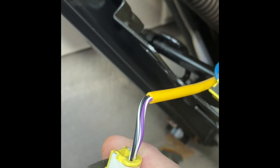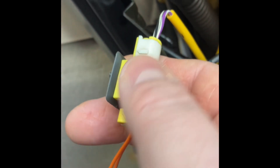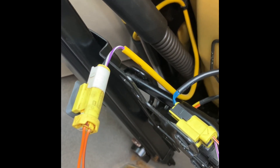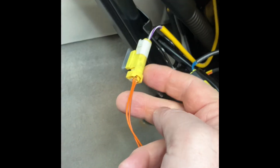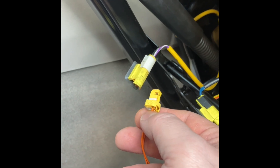I'll begin at this end here that meets up with the white and black wire — that's very important to remember so you don't get these wires wrong. Do not forget: when working on connectors or any type of in-car electronics, disconnect the battery totally before you touch anything. That's number one priority, or else you can risk damage to your car. Now I've loosened this so I can pull it out and start getting the wire out of the connector.